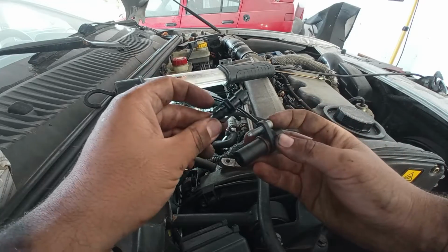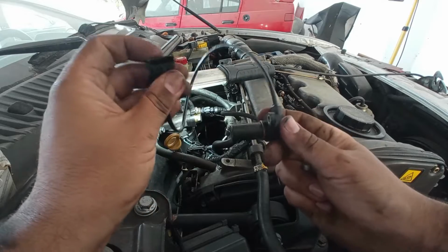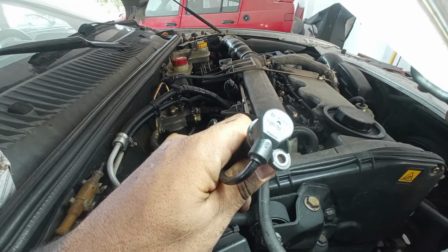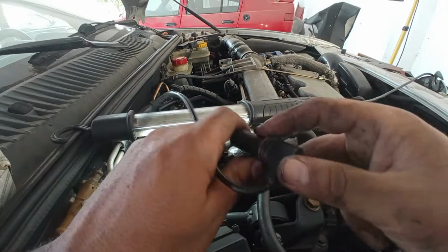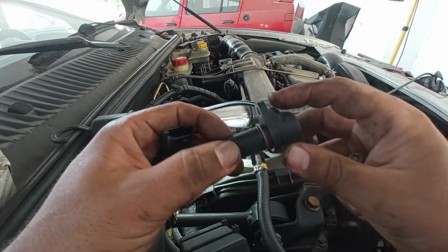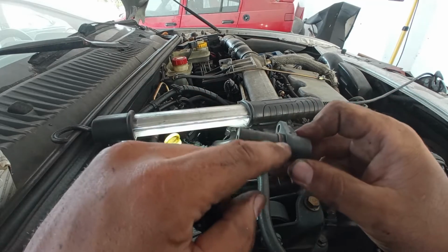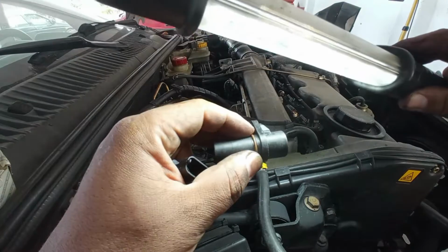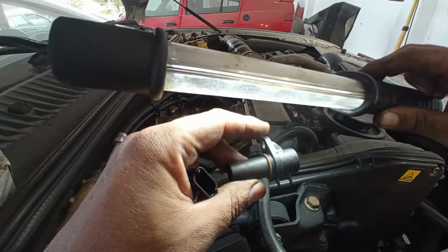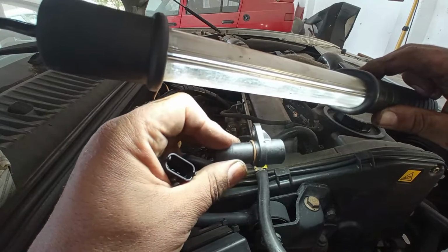Now, about this RPM sensor, I already did a video on how to replace it. One thing I want to point out is that this one is the one for the car, a Bosch, like the original, with the same part number. Everything was cool, except it was not. When I went to take out the bolt, it was loose. Okay, that can happen. And when I went to grab the sensor, it just fell down. Well, that is not correct, because you have this O-ring that you have to push the entire part in until you have a perfect flush finish on the sensor. Not only that, if you do not do that and you tighten the bolt, you can crack the part. It seems to be cracked already, and bent also.